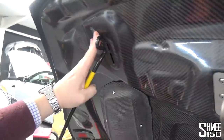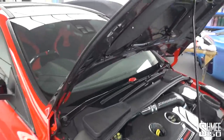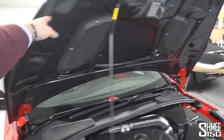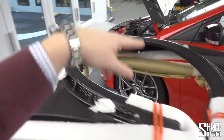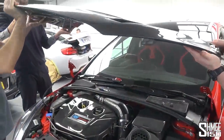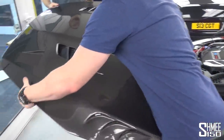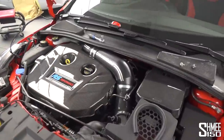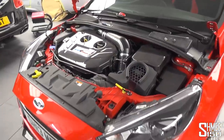We need to pop open the bonnet — pull the lever, being careful for a second. Obviously the bonnet is going to need to be removed, which means we'll need to take off the water jet nozzles. Inside, we're greeted by a lot more lovely carbon fibre. We need to take out some brackets, take out the water jet nozzles, and then we'll be able to take this off to get it worked on — talk about how we're going to mask it up, how it's going to be painted, and what we're going to leave exposed. And just like that, the bonnet was removed. It's only a few parts to hold it on — quite a large piece, but significantly lighter than the standard bonnet that actually came off the car.